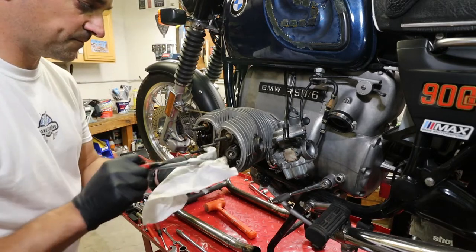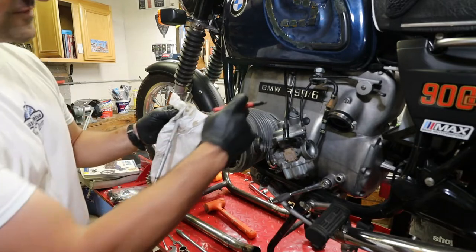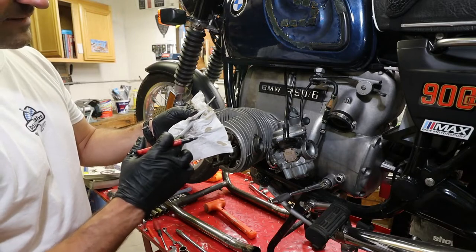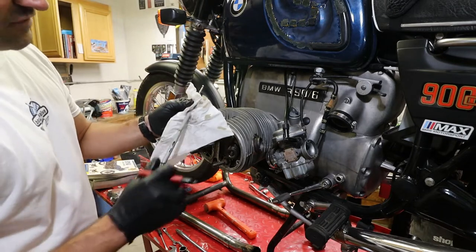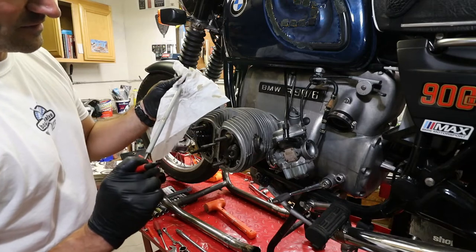That's good. There's some wear here in the middle, and that correlates right with a cylinder head gasket. And I wonder if either the cylinder head gasket is not lined up correctly, or it's a bad gasket, or the opening is not quite as large as it's supposed to be. But yeah, this is not good, and I definitely will take a look at this.